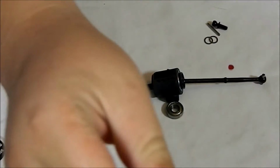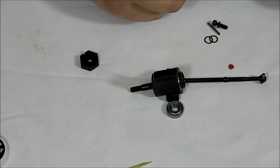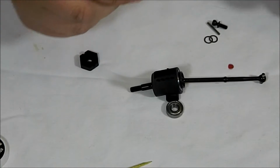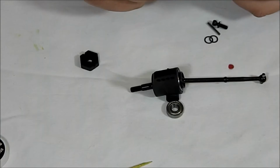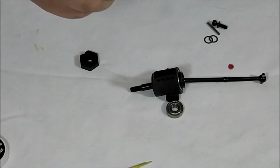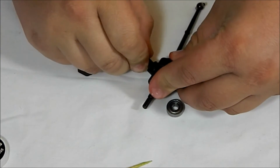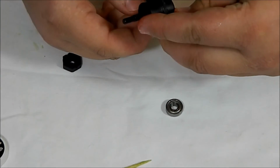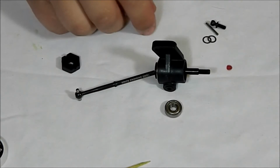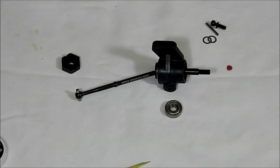Now we are going to be putting in our toe insert here. It is going to be your part number 330340-8. What it calls for is putting in the side that has -0 labeled on it inside first. So that is the side you're going to want to be putting in first on the toe adjustment. That is what it says from the factory manual. And then the next thing we're going to be doing, guys, is getting our ball stud on.